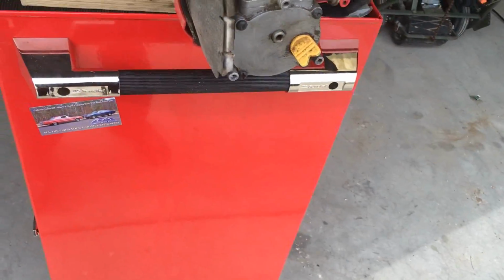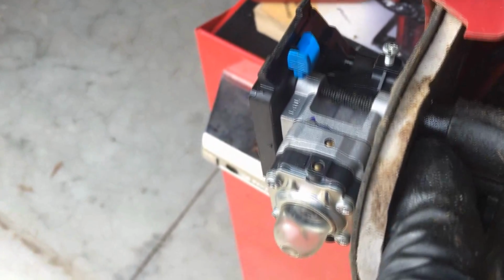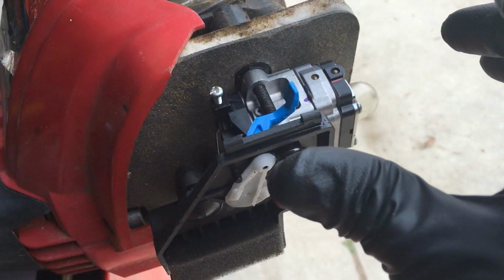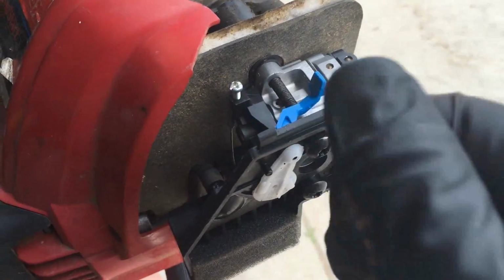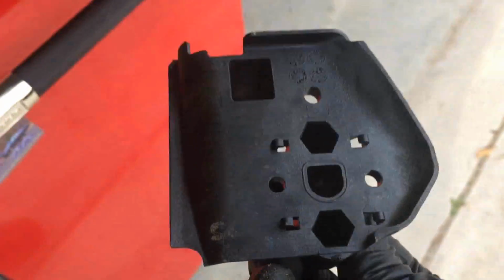So what I'll go ahead and do now, though, is throw the gas tank back on and then kind of start putting it back together. Because I do want to see if this thing will even run before I start getting into other things like that. On the intake, these 2 bolts that are going through it, there appears to be a couple nuts on the inside. If you look down below at this one, you can see it's kind of hexagonal shaped, like a nut is. So that's what keeps the nuts in place. So when you screw those 2 screws back in, you kind of want to start it first by not putting any force on the heads of the screws, but you just kind of want to screw it in, let the threads catch, and then kind of pull out as you're screwing it in, so to speak. Because if you lose those nuts and they go to the end, you're going to have a really hard time putting them back on there if you're in the same situation I am in with these seized screws. So just wanted to throw that out there just in case any of you came across that.